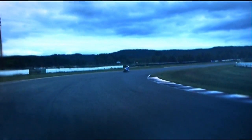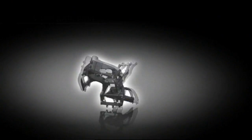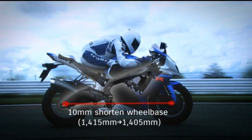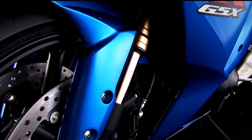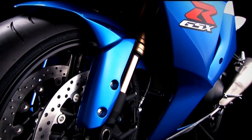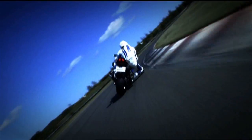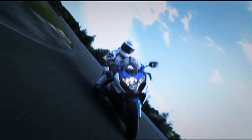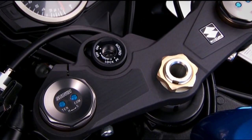The more compact engine enables big changes in the chassis layout. While the swingarm is 33mm longer for better traction, the wheelbase has been shortened by 10mm for better handling. The front forks have a new cartridge-less BPF design that gives more controlled compression and better feedback to the rider, and the design reduces fork oil foaming for more stable damping.